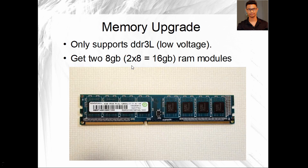After the CPU, you need to do a memory upgrade. These computers come with either 4GB or 8GB — the version I bought came with 8GB. The main problem with this machine is it only takes low-voltage DDR3, so make sure you get DDR3L — the L stands for low voltage. I got a RAM from eBay for about $9. There are only 2 memory slots, so you can put a maximum of 16GB — get two 8GB sticks. I tried putting a regular DDR3 in there and it would not work, so make sure you get DDR3L.